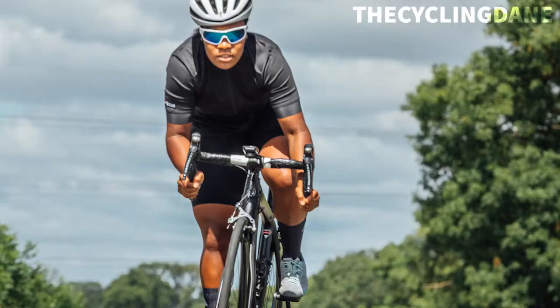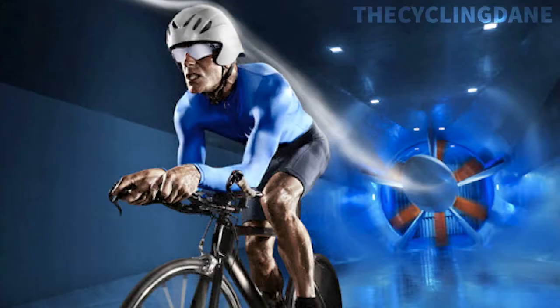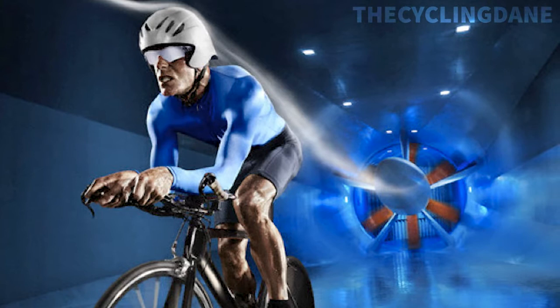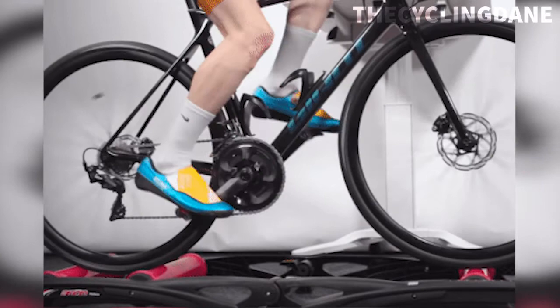So in theory, we lower rolling resistance — we're not only saving energy, we can perhaps reach speeds of 20 miles per hour by using as much as 200 watts rather than 300. Provided you are already aerodynamically optimized at this point, because your aero profile will always be a priority, as drag slowing you down is all you, the rider. But you certainly will make a difference in manipulating your bike's wheels' rolling resistance to suit you.